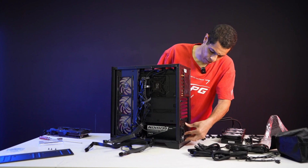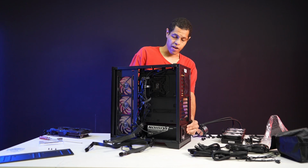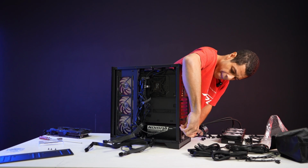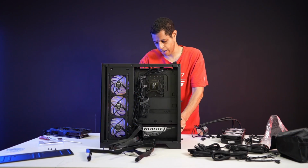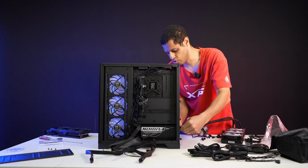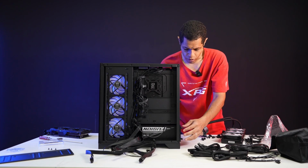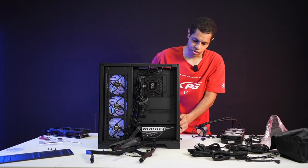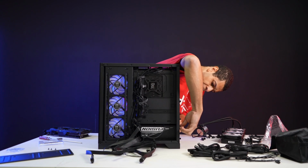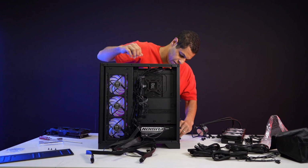If I could show you a better angle, if I had another camera, I'd show you that, even with it going all the way in with the cables, you've got plenty of room. But you do have to make sure, because of the way it's built, because it is a pretty compact case, you have to put the cable connectors on before you put the PSU into the case, or you won't have enough room for your hand to add them. So if you want to add a cable, you will have to take the entire PSU off to then add another cable on, which is not too bad. And so yeah, okay. So toolless, connect it back into the case. Very easy.